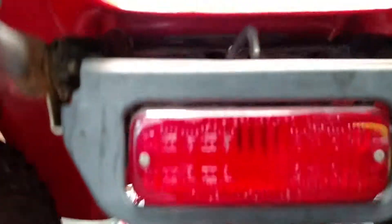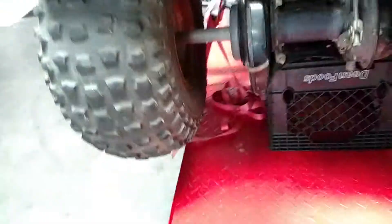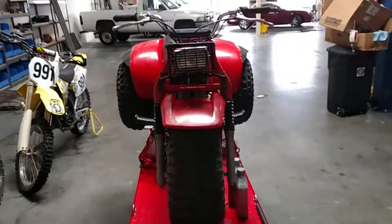Exhaust — got a spark arrestor in there, which is good if you're a California guy. Look at the axles, roll it backward and forward. If it doesn't run, make sure your axles are there. Then I just look at it overall, see how straight it is. Stand in front of it. Sometimes tires are flat, so it's going to be kind of wampus.